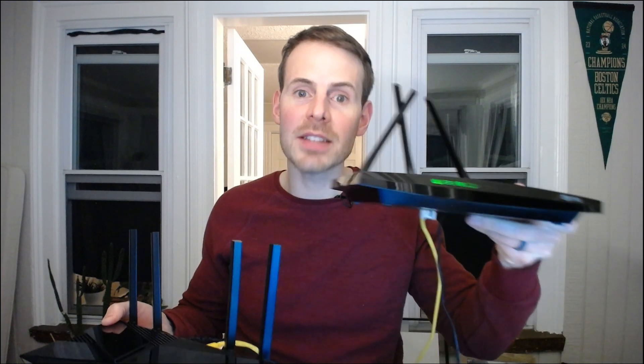At this point, that's all you need to change in your router settings, so you can log out, and now everything should be working properly. One limitation I just want to bring to your attention is that between your new router and your access point, these obviously need to be connected with an ethernet cable. So the longer the ethernet cable you have, the better off you'll be — there obviously may be limitations with your home as well. Regardless of how long the ethernet cable is, you will still get a Wi-Fi signal boost by using your old router as a wireless access point.